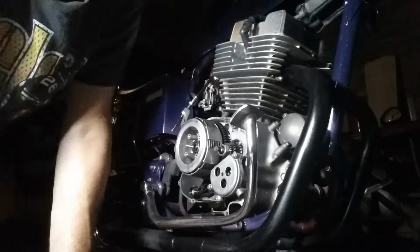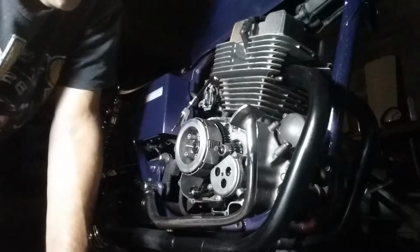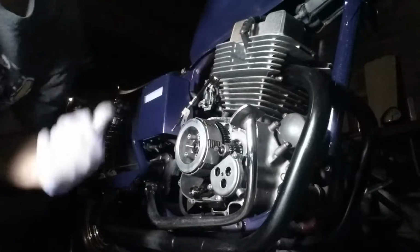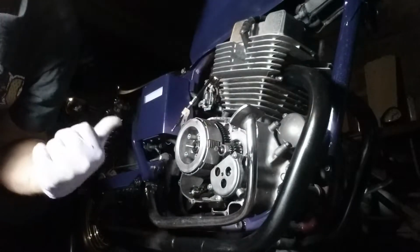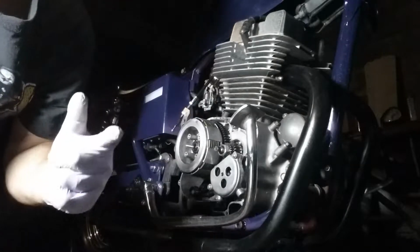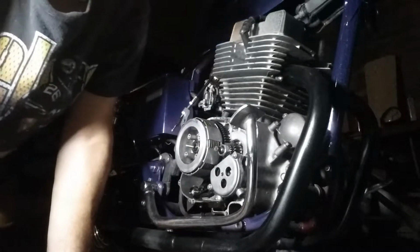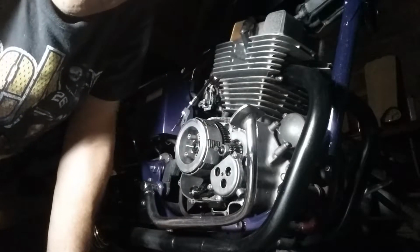This is torqued down to 34 foot-pounds. What you're going to want to do is put the bike in gear. You're going to want to lock up your rear tire with your brakes, adjust your rear shoes so that it locks up the rear tire. Plus, the bike has to be in gear. Plus, your motorcycle front wheel should be against something like a wall.